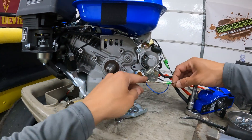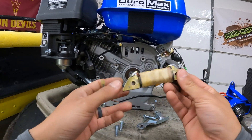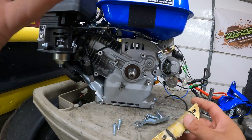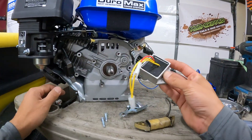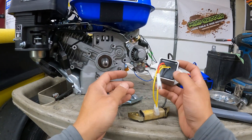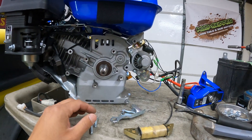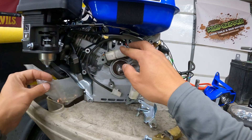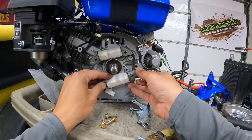The brown wires are going to be the charge coil — we can disconnect the old one since we won't be using it. Some setups sell you a second coil to add on top of the original, which would double what you have, but the ideal benefit is actually going to the full bridge rectifier. A second coil added to the stock setup might only give you another half amp, which is minimal. The kit does come with new hardware — all four bolts — so you'll be all set for the installation.